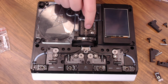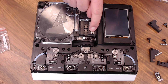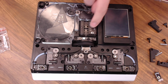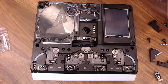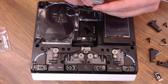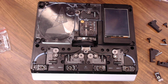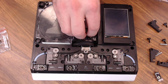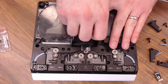While the cover is off, go ahead and remove the splice core. This is one where I had a problem with the thumb screw not being long enough — I actually had to use a regular M3 screw with a wrench. On yours you'll just have a regular thumb screw. Take the old splice core out, drop the new splice core right in, and the new chrome thumb screw they give you will hold the splice core on. These thumb screws are all just a little bit longer, so they're going to work quite a bit better.